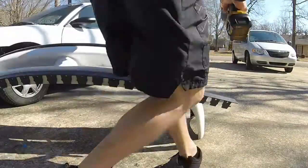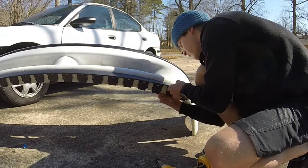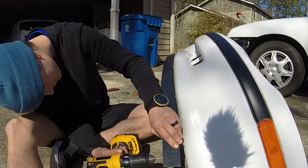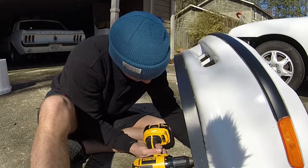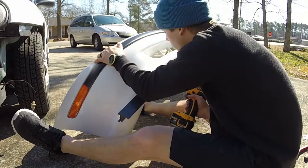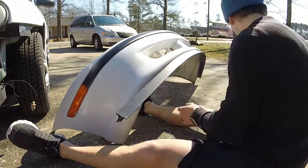When you get to the end, it does take a little bit of force to bend it — it helps if you have somebody to help you. I drilled the hole in the lip first, then bent it down and drilled through the bumper, and quickly pushed a bolt through the holes. The lip really did conform well. It's a pretty strong plastic so it is somewhat hard to bend, but it doesn't have any issues pulling itself back out. You can see the lip really does bend around the bumper and conforms to the shape well — it really is an OEM-looking lip for about eight dollars, which is incredible. Just do the same on the other side, work your way down the bumper, and slowly bend it around.